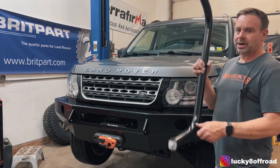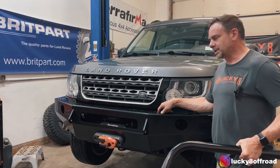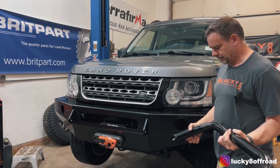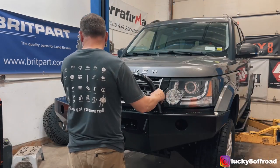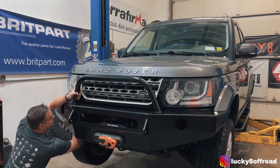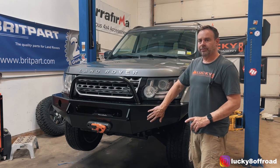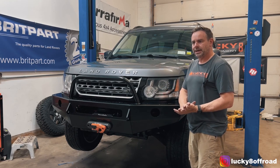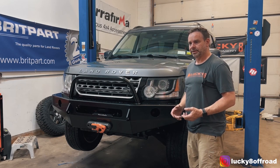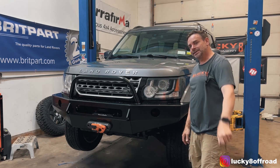Last thing to do is put on the A-bar and the job is done. You'll see the two studs on the bottom — they go through the holes in the wings. Set it up there, you can reach up from the bottom and tighten them up. And there you have it — job done. In another video I'll show you how to do fog lights using Baja Designs, and I'm also going to do a video on how to install the lower bash plate and skid plate. But for now, I'm going home — I'll see you guys on the next one.